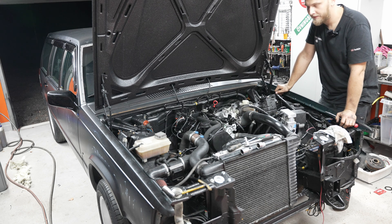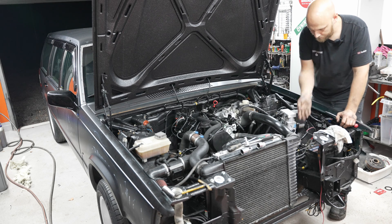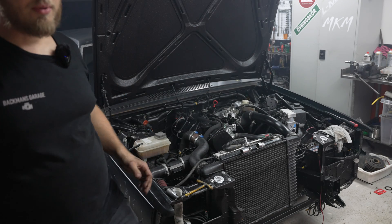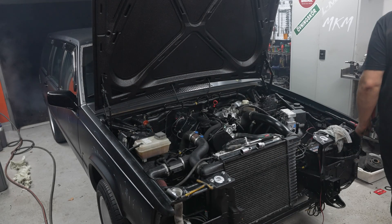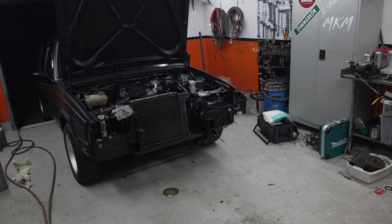I'm not on the gas, by the way. I think the idle air controller is trying to find out where idle is. We're going to run this thing for at least five minutes. I'm a little uncertain about the turbo — turbo could be bad, I'm not sure. Got no warning lights — this is good. We're almost up to operating temperature. I'm going to turn on full heat. It's hot in here now. It's running pretty rough though, I gotta say. Something is off — something needs an adjustment somewhere.